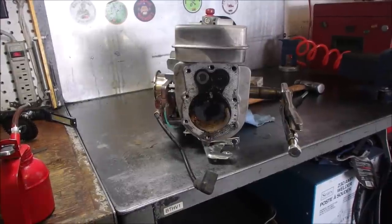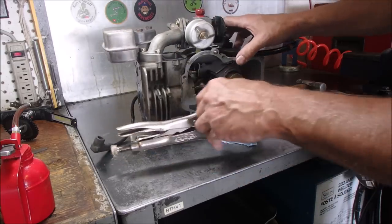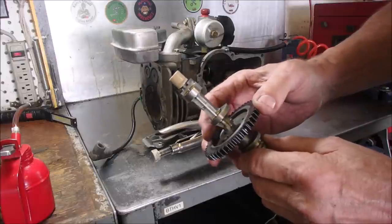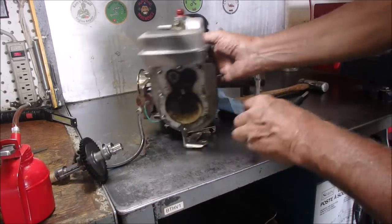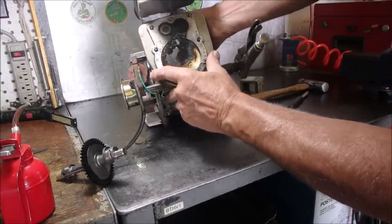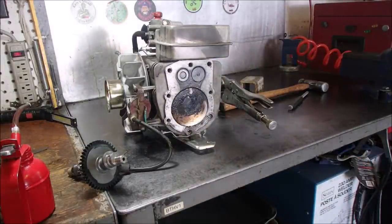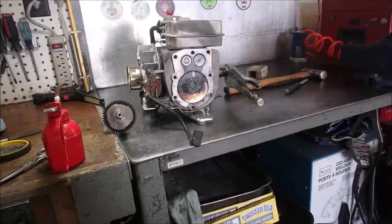Okay. Hi guys. So part of the problem with Tecumseh is that the carburetor and the muffler are on the same side. So the exhaust valve has to reach way further, so this little mechanism has to reach way down to the exhaust valve on the other side over here, and I'll just give it a little flick for you here. One, two, that should do it. And it's pretty darn stiff, eh? All we want that to do is let a little bit of air out and give us a release of compression so that this thing will turn over a little bit easier. I'm not quite sure what to do here. I've got that valve moving a tiny bit. That's without it being assembled, right?